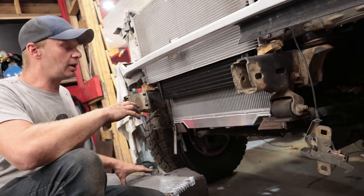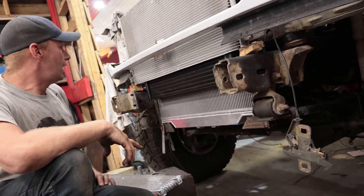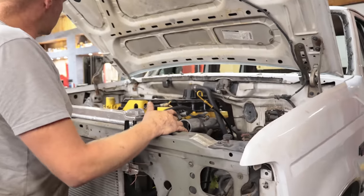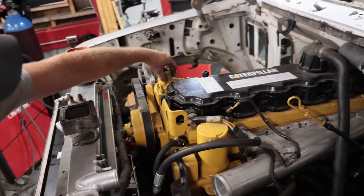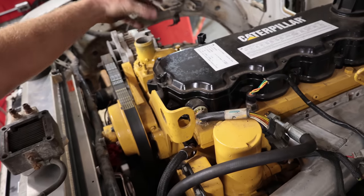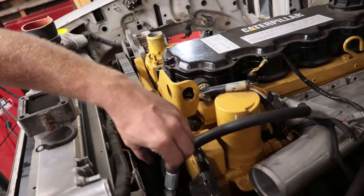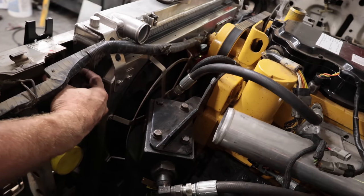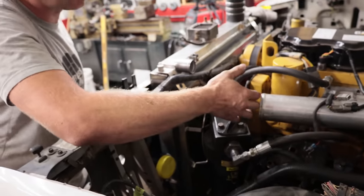I want to find a longer, skinnier power steering cooler, so we'll probably head to the wrecker Tuesday morning for that. We're going to continue mounting all of our coolers solid, but I need Vince — he's coming tomorrow. I'm tacking the rest of the intercooler piping together and we can go from there. A couple of things we have to fabricate: this aluminum housing went straight up and we need it to come straight out. The upper rad hose will come nicely around to the top, but it would have been nicer if the intercooler pipe came out right at the top.